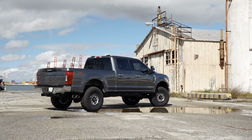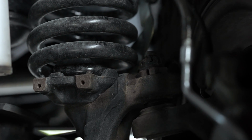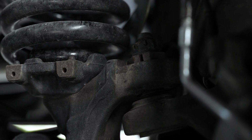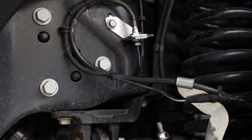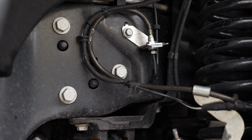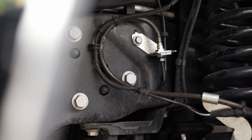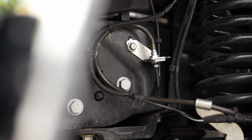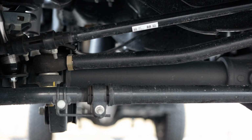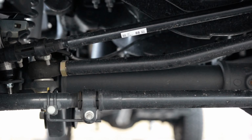When you're lifting the front of the trucks, there's a ton of things that change. First of all, the caster. If the kit is not including caster shims, you need to look at a kit that includes caster shims to avoid death wobble, poor handling, poor driving characteristics, and things like that. Brake lines. If you're looking at a system with a longer shock, longer spring, like what Carli makes, you're going to see that the stock brake lines are not long enough. Now, a lot of brands will give you a tab where you're stuck bending your hard lines and things like that. I personally don't want to do that on my brand new truck. I don't think you do either. Now, instead of buying a cast overseas drop bracket that maintains that factory track bar that's eventually going to wear out, you're getting a heavy duty track bar that does have slight geometry correction built into it.